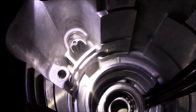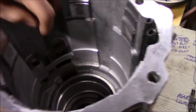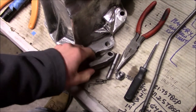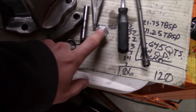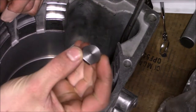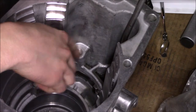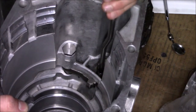Next I'm going to install the parking pawl stuff. First I'm going to install this little guy with the pin that fits in that recess down there. This funky little snap ring sits on top to retain it. Next I have to install the actual pawl itself, the pawl shaft, the spring that makes it springy — and that guy gets torqued to 20 foot-pounds according to the manual. Next I'm going to install the bolt that retains the rod, which is seated in that hole now, with the hollow end facing up so it's easy to extract.